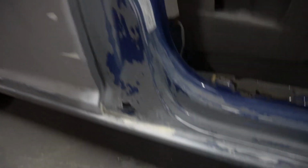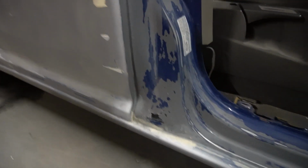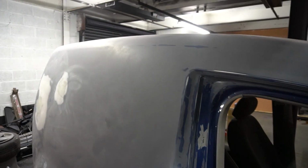Prime's okay. So I'm going to prime the full van, but it does rub off with thinners, so get all this off, scuff it with a Scotch-Brite, and then just whack a load of primer on it. I'm going to prime it without the doors on, do the full van, spray it one colour, and then I'm going to spray the doors separately as well as the bumpers.